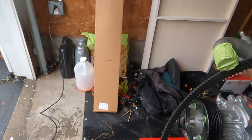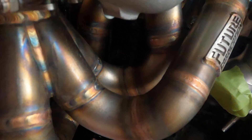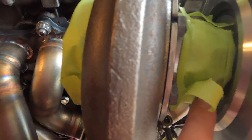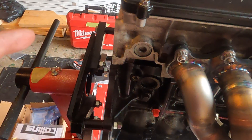When you're running a GTE and you upgrade to a single turbo, from the factory you have a heater line that comes off the back of your water pump and it goes to the back of the block. You actually have about two outlets for the turbo hoses to cool it. I'm not gonna be running mine — I'm probably gonna block that off. There's a hole for your oil feed and for coolant taped off right now.